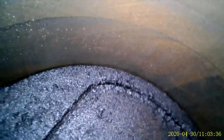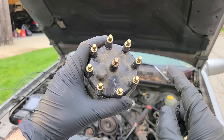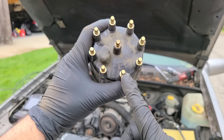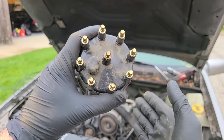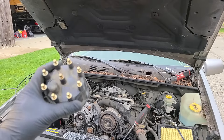This thing has definitely been sitting a while — you can see a little bit of rust buildup in the cylinder wall area and where the ring was resting. If this was something more expensive, it's a good idea to fog the cylinders first. It was cranking over so easily by hand I wasn't worried. If you get a lot of resistance, fog it out to loosen up rust around the rings because you can snap one off. But the ring lands are looking good, the piston looks good, the cylinder looks good — cylinder one is good.